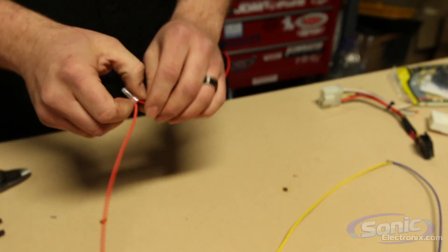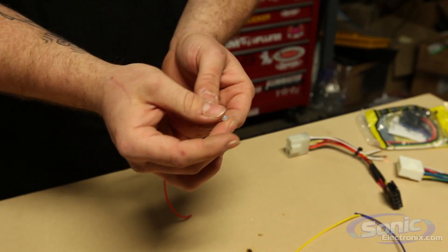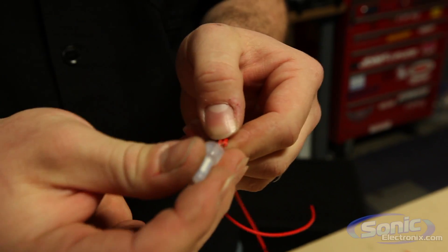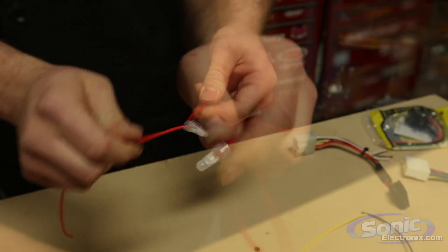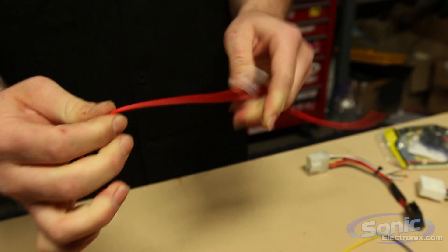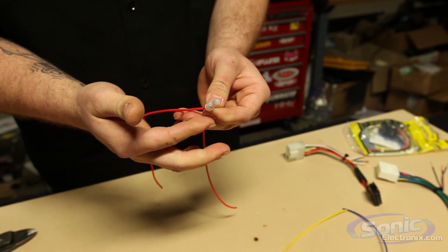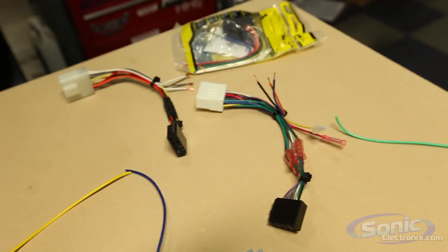Granted, you do get some bulk on that harness from the butt connector. Next, we have our crimp cap which is actually the simplest connection that you could possibly make. It's very similar to a wiring nut in home applications, but we actually have to crimp it instead of just screwing it onto the wire. This is very basic, straightforward, makes a nice solid connection. The downside is if you can imagine having about 13 other wires around this with crimp caps, you're going to have a pretty bulky harness to try and get back into that dashboard.